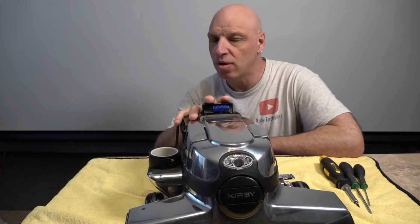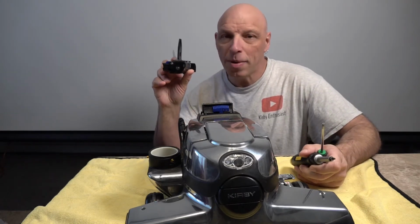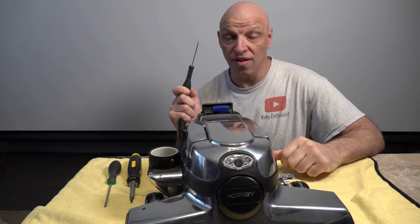It works the same process across the G series as well. Really simple to do. There's four tools you're going to need. Obviously your Kirby, a new Kirby pivot assembly, there will be a link in the description of where to get one of these, a Torx 25, a Torx 20, a Torx 15.